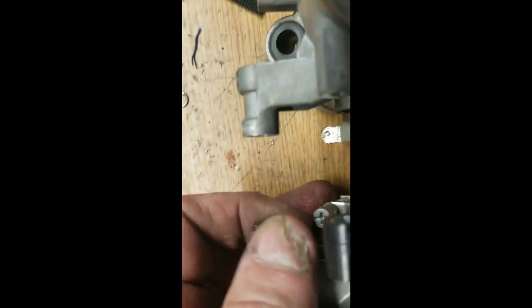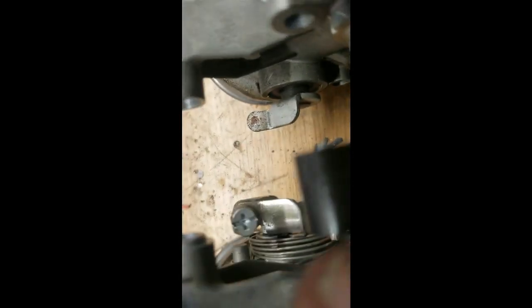The lower two sets are easily separated because there was a piece right in between these springs, as you would on a set of carburetors, and they just slid apart very easily. But this has a pin driven through it so it mates with the little motor here that turns these secondary throttle plates. So I have to drive that pin out so I can slide this shaft completely out and actually separate these two sets.